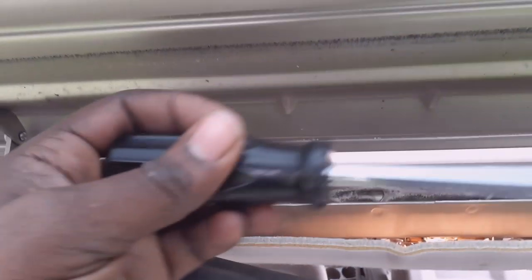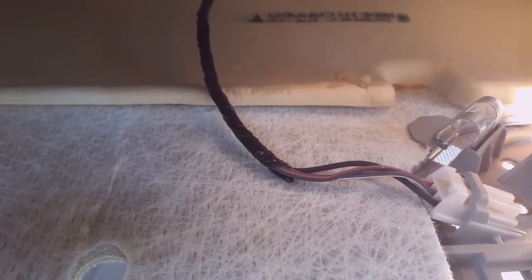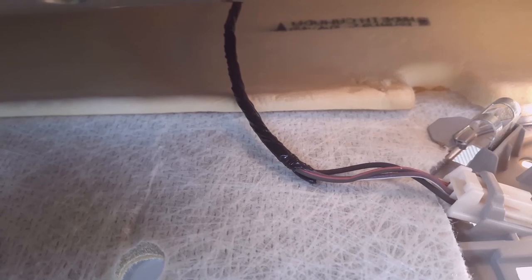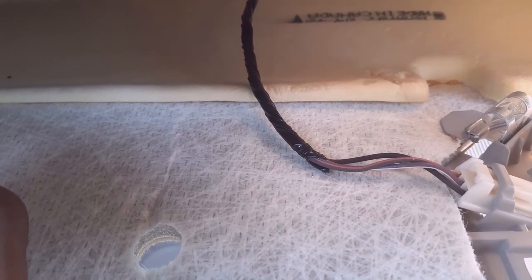You take these little tabs — I was telling you about panel poppers, upholstery removers. There are four little tabs up here by the back dome light on the van. Pull this down and you can see a brown with a pink wire — that's the wire you want for your dome light door trigger. I'm going to show you how to put the diode on it and draw a diagram. I'm going to run this wire to the front. Like I said, most installs don't require this but on this one you have to isolate it.